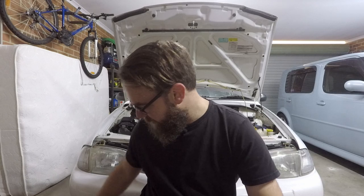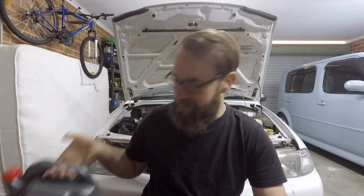Finally, we'll change the oil filter and put in some more cheap oil that was on special. After that, we're going to run it for another 1,200 kilometers — the same age as the current oil that's in there — and then we'll take another look inside the valve cover and generally see how the engine is running, if it's still even running at that point.